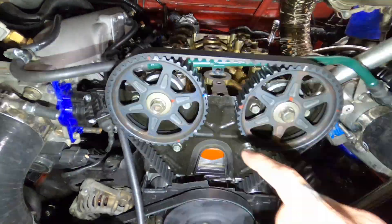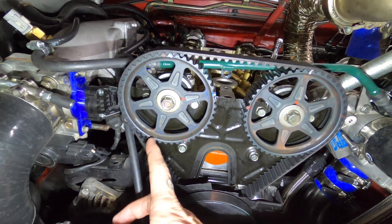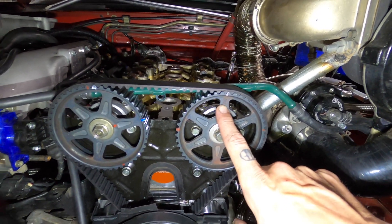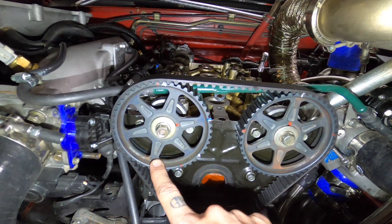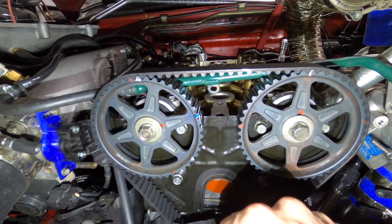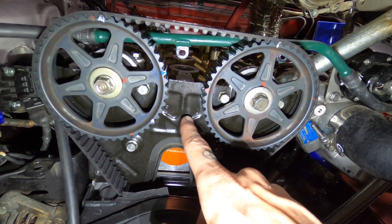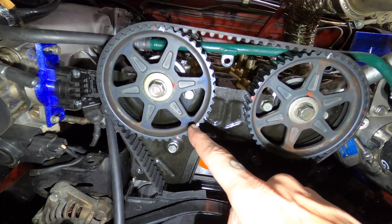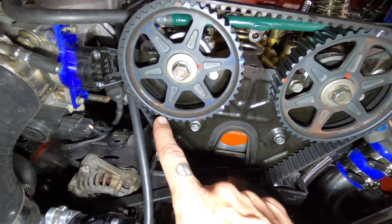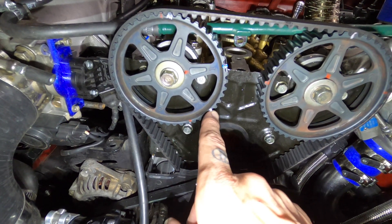I've got most everything reassembled. One of the things I want to show that matters most is how the timing works. The E mark — there's a line here, and this is where you would normally line it up. You can see the E is up and the I is down, because this is the E for the exhaust side. Normally the I would be up and the E would be pointed at this little plate where an E is pressed in. The I is facing the nub that sticks out. This is our new white mark — I just used some white acrylic paint. So what we do is count 9 teeth from this mark: 1, 2, 3, 4, 5, 6, 7, 8, and 9.